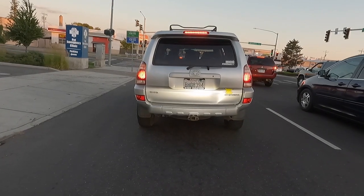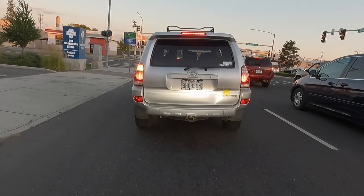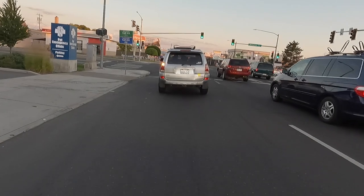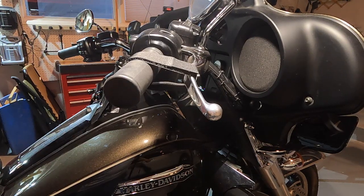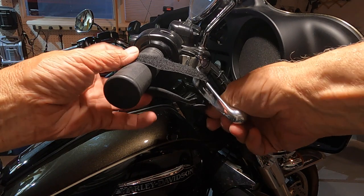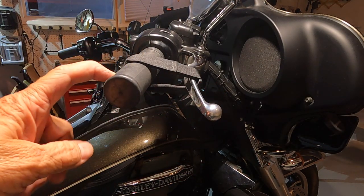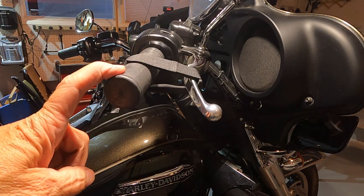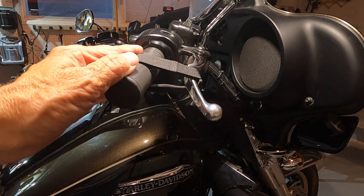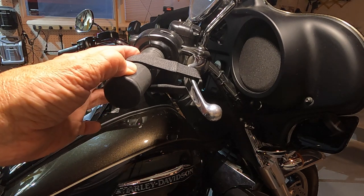You can't put it in gear to hold your bike from rolling, so for a two-wheel bike they give you a cinch strap. I got one with mine, but I have a Tri-Glide so I have a park brake. The cinch strap goes around the front brake lever — you pull the front brake lever tight and cinch it down, and it acts as a park brake. Because when you stop the motorcycle the clutch is disengaged and you can push the motorcycle around. And because it's disengaged while the engine's off, you cannot compression-start the bike anymore.